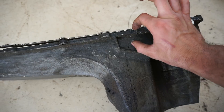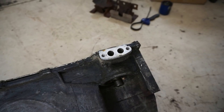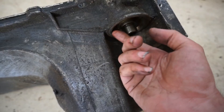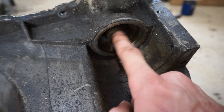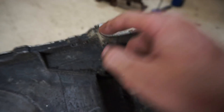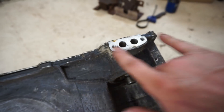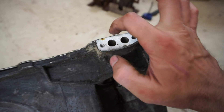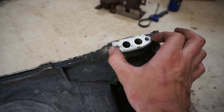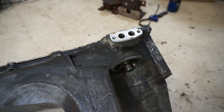I'll weld to that section after cutting the bottom off. What I want to do is connect these two separate channels down in here after cutting. Then I'm going to put a cooler plate on there that bolts on with a dash-10 out and a dash-10 in. This will be used for the remote mount filter — oil will come out and come back in, everything blocked off appropriately.